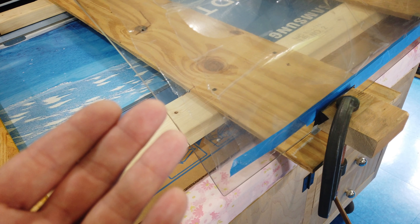Once I could get the canopy open and closed freely I installed the struts - they work fine, but I noticed my gap especially on the sides closed up to almost nothing. The side gaps were not an eighth-inch because once you move the canopy these sides shift backwards, but the top tends to carve into the skin first. Putting the struts on pretty much closed that gap to nothing on both sides. However, I put nut plates on the frame and used flathead screws as jacking screws - as the canopy comes down those screws butt up against the framework, so I adjusted them slightly to restore a little gap even with the struts installed.